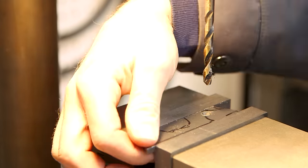There are some things I learned while doing this that you ought to know. The first has to do with clearance between the frame and components. I said earlier that you could fit a road or gravel crank to this frame — while that is true, you might run into problems with clearance between the chainstay and the crank arm. I've only got about 3mm of clearance between the crank arm and the chainstay. If I run into contact issues, I'll have to modify the chainstay later. I didn't figure this out until I was putting the bike together because I was waiting on a bottom bracket. If you're doing this, fit your crank and bottom bracket early in the process so you know if you're going to have clearance issues.